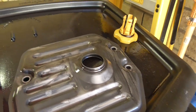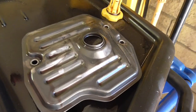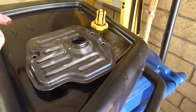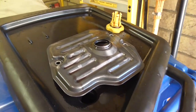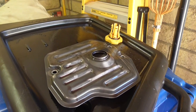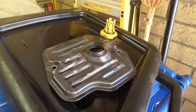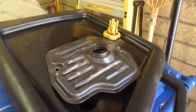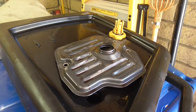I'm kind of glad that I changed this at 50,000 miles. Get some new fluid in there and get it running. It took four quarts to fill it — a little over actually. The price of that fluid is going up — used to be five bucks a quart, now it's ten down at the dealer. Double the price in seven years.